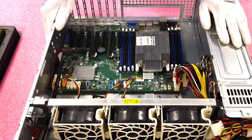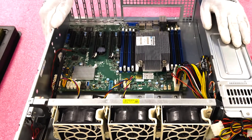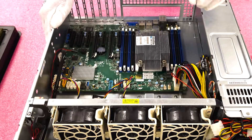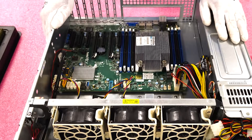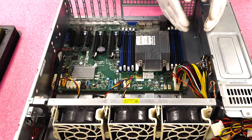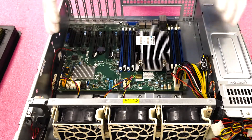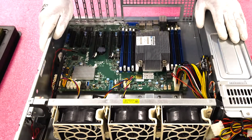This is important to note. Let's say you're only putting in four modules — four 16GB or four 32GB, it doesn't really matter. You want to put them into the four blue slots, because you want to maximize your performance overall. You don't want to overload two channels and have the other two not working for you at all. You want all four channels evenly distributed, all working equally hard — that's how you get the best performance.